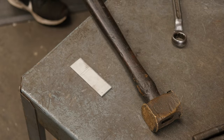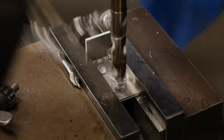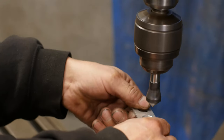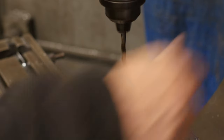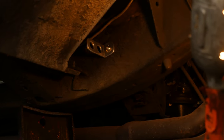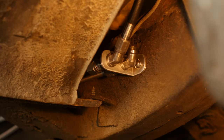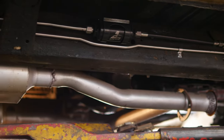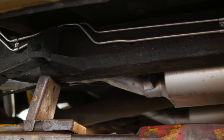Here Roy is making a bracket for the fuel lines with a junction point at the front part of the frame, bringing the two fuel lines to a meeting point there. From there we'll run flex lines up to the fuel injection. He'll run stainless steel bulkhead through-connectors to that junction, then connect the flex lines that go up to the fuel injection. Here's the completed fuel line system — all the lines, all the unions, all the stainless bent nicely, curving around and back to the fuel tank.